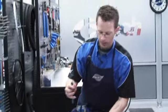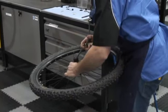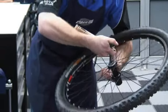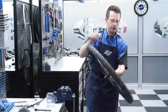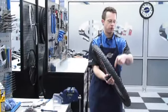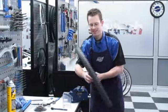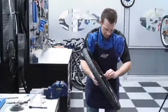Now I can pipe some grease onto the bearing surfaces, slide the axle through, and try to give the hub a fighting chance. I try to put in a good coating of grease — this is going to hold the bearings when you put them in as well. Hold the wheel at about 45 degrees, and when you drop the bearings in you're going to drop them onto the race itself and not through the middle. It doesn't always work, but it's a good tip.